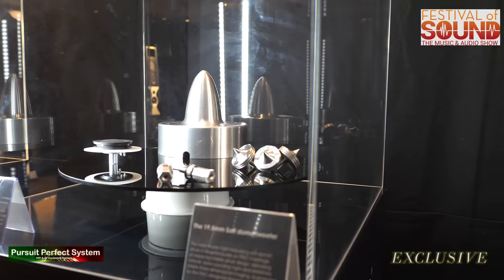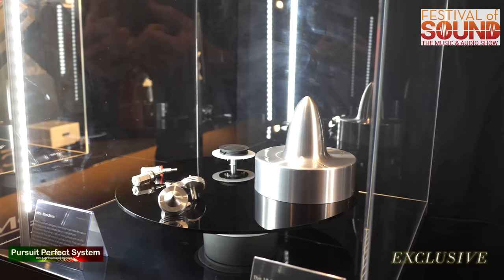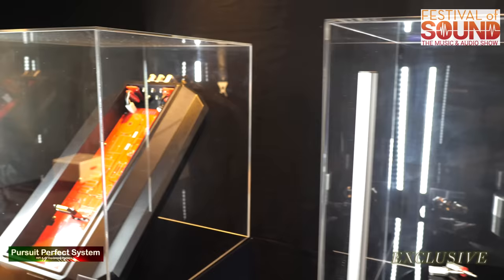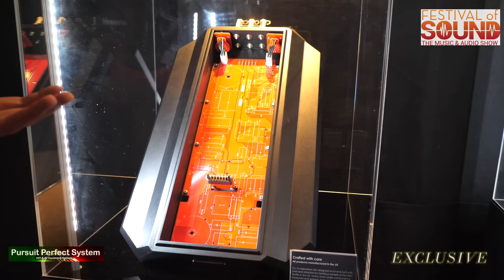We've also got our new terminals here, which are solid copper with rhodium plating, which we get made specially for us. There are stainless steel feet, which are very nice. And you can see the tweeter with its compliant mount — we clamp that gel ring into the cabinet so the tweeter itself is basically floating on the gel mount and is completely isolated from the speaker's structure. This here is a dummy model of our plinth. We've been really obsessive about anti-vibration in this loudspeaker — the whole crossover is mounted on anti-vibration mounts as well. You can just about see them underneath the screws, the small black rubber grommets. That further isolates the crossover, stops any micro-vibrations passing through, and keeps the mid-range and sound as pure as possible.